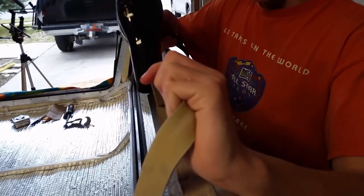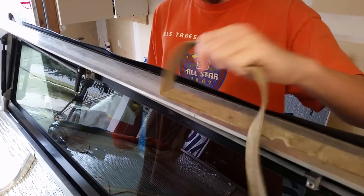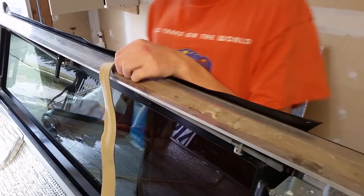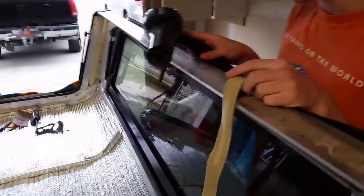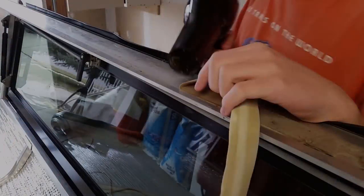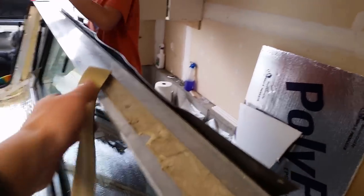What you doing? Oh, I'm just taking out this old weather stripping. How's that? I came up with this idea. Instead of yanking and carving on this sucker like a Neanderthal, I thought, why not make it warm? And it pulls off really well with just a regular hair dryer on the hottest setting and just low fan. I've done this whole way and there are like no woogets left except for stuff that was already there.